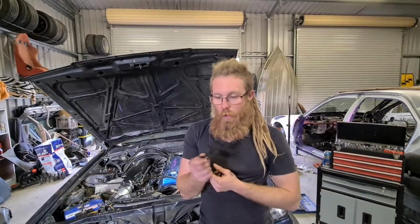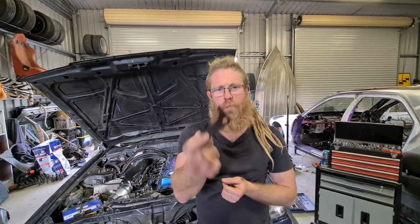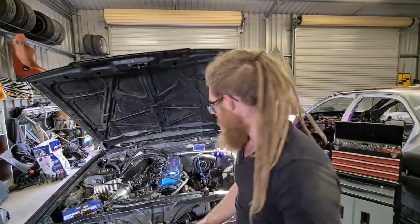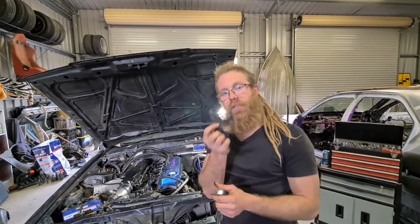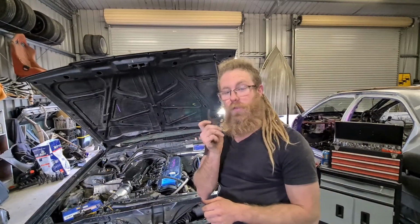So I knew I had blown a piece out of it, but I wasn't expecting that I blew half of the gasket away. That's almost impressive. That's a new one. I've never blown out a metal gasket that well. Oh, anyway, I should have another one in the drawer. I'm gonna say a leak of half the flange was probably the reason I wasn't making boost.